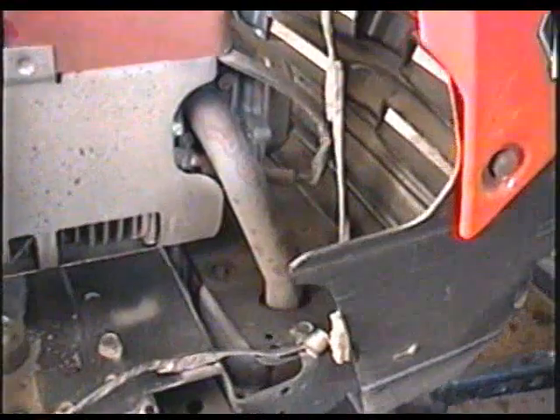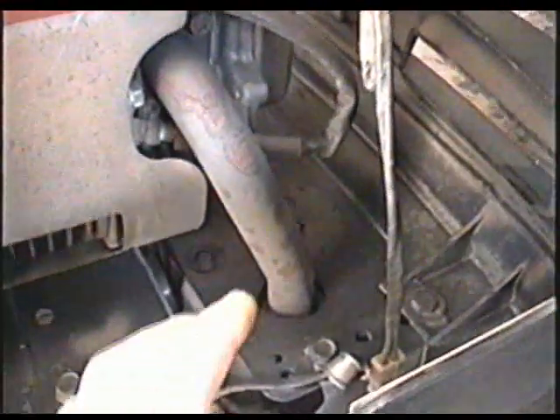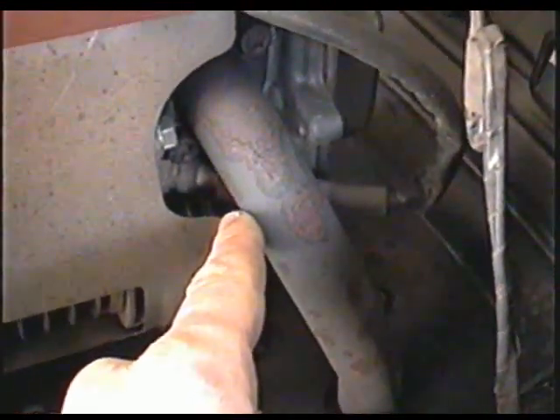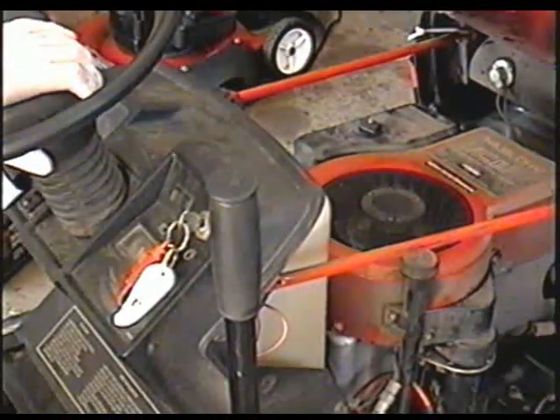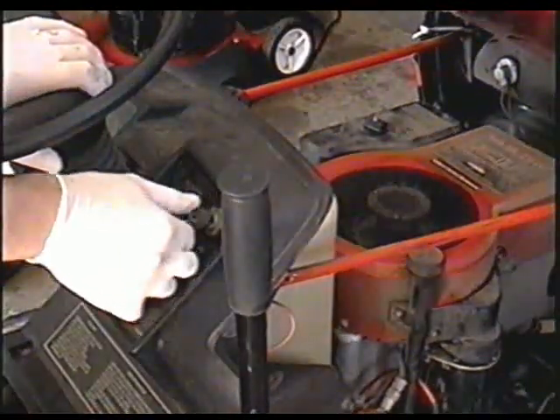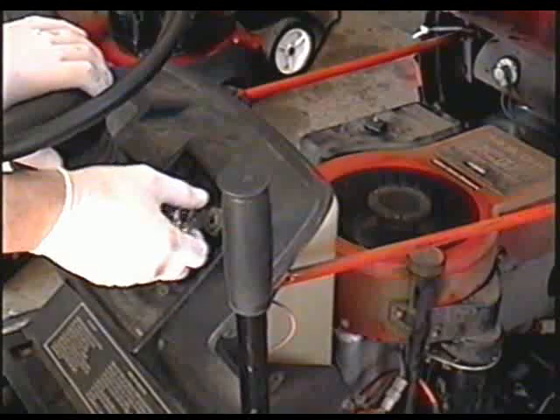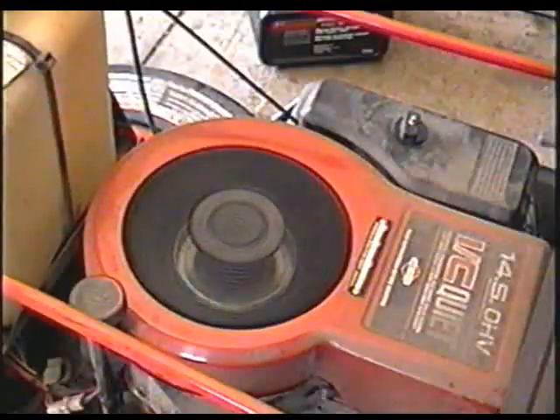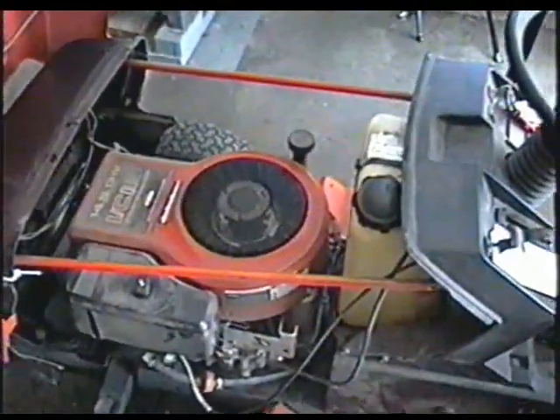This is the last option remedy that I'm doing. First of all, to make sure your starter is good, just remove the plug right out of the engine — it's going to be easier to turn over and you'll know the starter is still good. I've got the spark plug out now and I'm going to turn the key over to make sure the starter is still good. Once you've done this you know the starter is still good and you know for sure you don't need to replace the starter or the battery at this point.